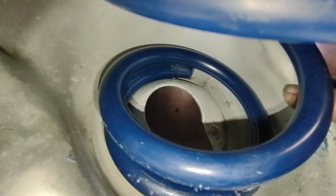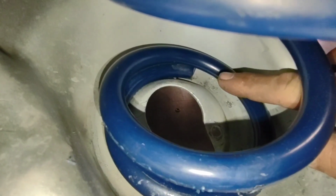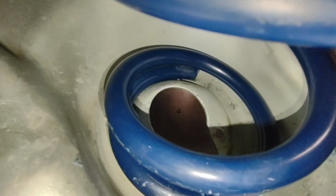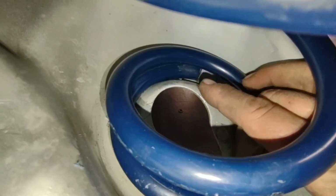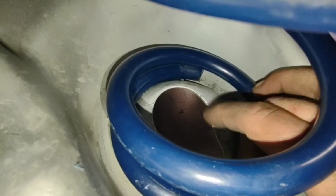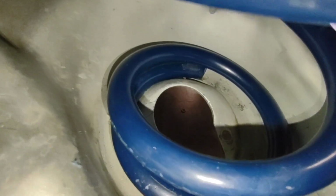When installing your springs, make sure the pigtail for the spring is on the bottom and it's located in that low spot in the A-arm. Every A-arm that is used for a pigtail spring will have that indentation to locate and time the spring correctly.